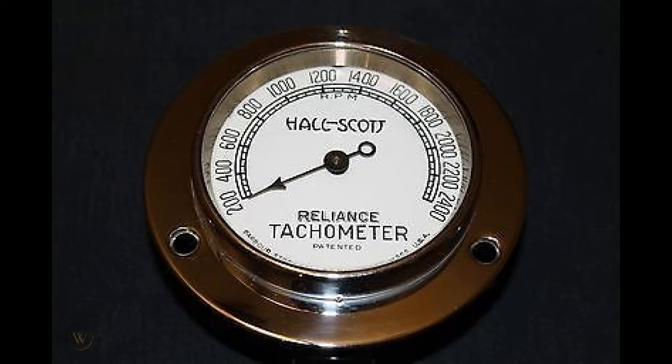Although you had a variety of different engines, the T-head was the most common, and T-heads are slow revving engines as it is. So what many manufacturers would do, as opposed to installing a tachometer, was install a governor on the engine to keep it from over revving. The first Benz cars didn't have tachometers, the first Daimlers didn't have them. You did start seeing them in race cars, like the Panhards and Levasseurs and the Peugeots and the Mors of the 1890s, but on a non-race car, they were pretty rare and didn't come into play unless it was a sports car of some sort.